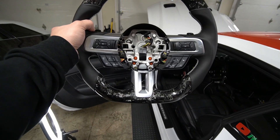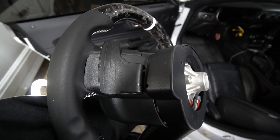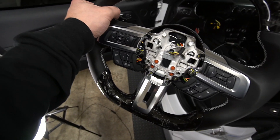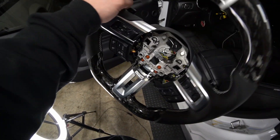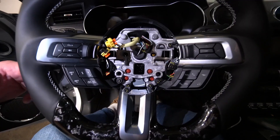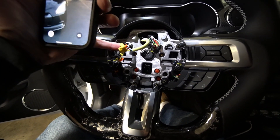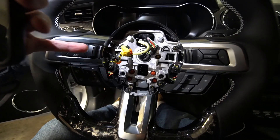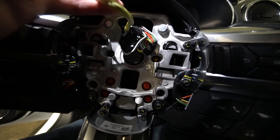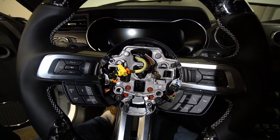The steering wheel was worth the money — it was kind of expensive, but it looks good in the car and I like it a lot. The only thing is I need to get new paddle shift extenders; they do sell carbon fiber ones. To get to them I'd have to remove all the buttons front and back. Next step is to make sure you plug in that big wiring harness at the top and torque your bolt down to spec. The rest is just the two airbag plugs. The steering wheel is clipped in, it's straight — there are two little yellow guide dots that slide right into the holes to keep it straight.